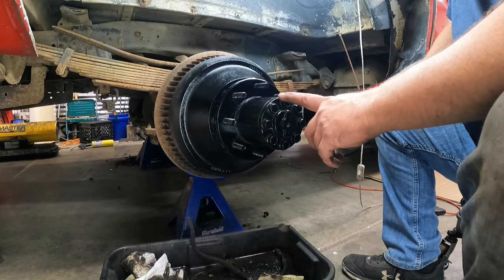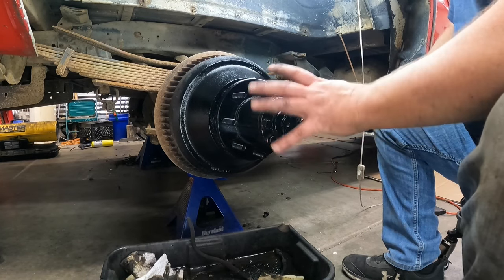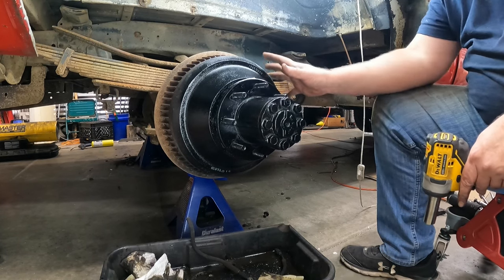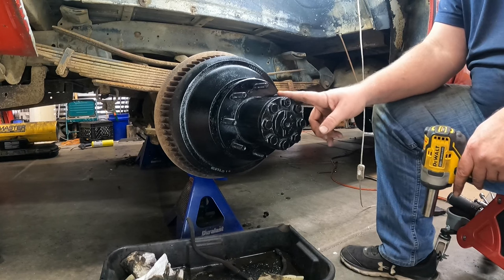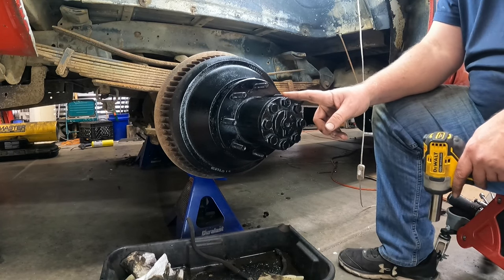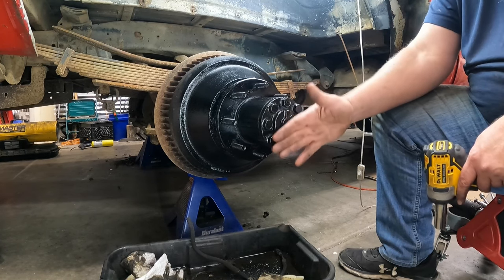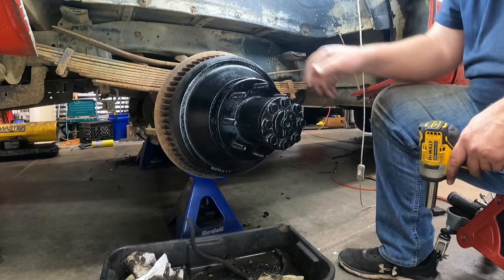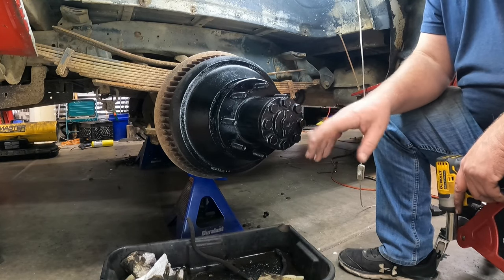So we're now on the passenger side - I was trying to record on the driver's side but it's too tight quarters to get a good camera angle. Tearing down these dually rear ends - this is a 14-bolt, pretty much the same as a Dana 70. When you're doing a 14-bolt or a Dana 70, which is what you'll run into on these old square body Chevy duallys, it's a full-floating axle. That means this axle shaft sits on a bearing out here and hooks directly into the differential.